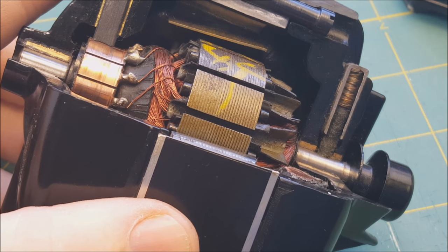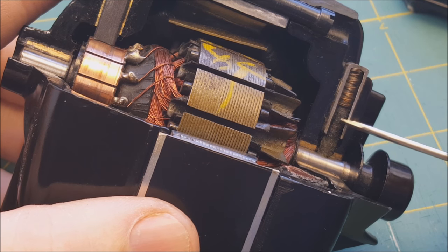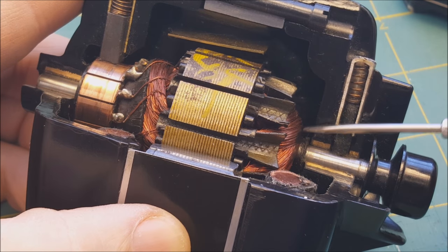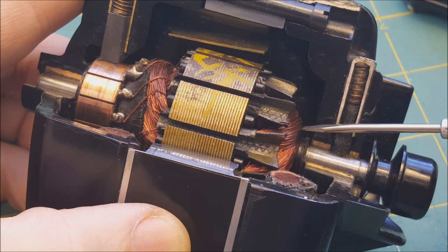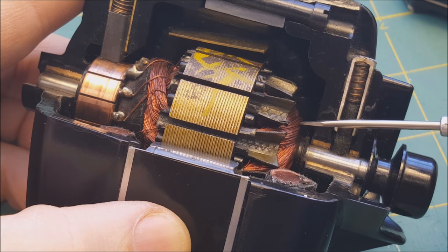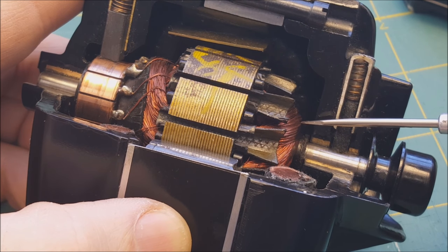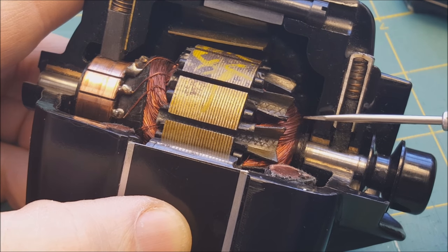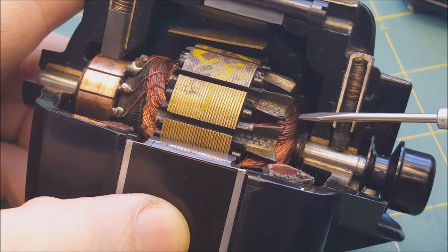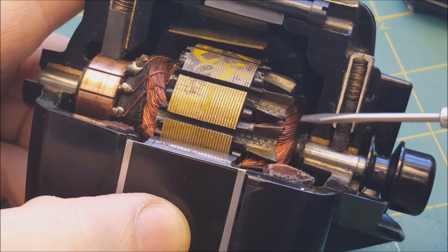One of the reasons we say don't ever put oil in the motor is because if you dump a bunch of oil in here, it's just going to run quickly through that felt. And ultimately it's going to get over to the wiring on the winding of the armature. If that happens — if you're looking at a featherweight to purchase and you notice that the motor smokes a little bit — that's not just that it needs cleaned. It pretty much means the motor is shot; somebody has put oil in there, and it causes the wiring to overheat. It's basically a no-good motor at that point.